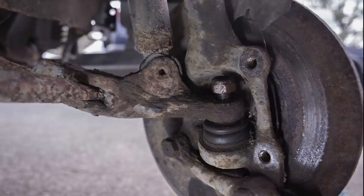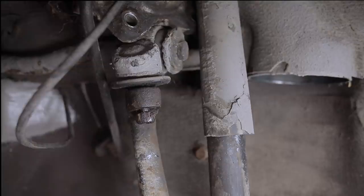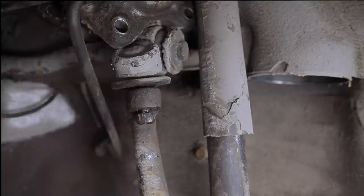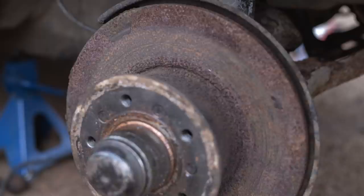It almost goes without saying, throughout this video and throughout any build, a decent hammer is an absolute must. And in a section where I want to tell you that, as far as I'm concerned, a claw hammer has no place in a mechanic's toolbox, I still managed to catch this ball peen in some of the brake wiring. Hammering on the side of ball joint tapers is a no-brainer, because the odd time that they do just release easily, it's a joy. I personally would prefer to go at them with a proper tool, i.e. a ball joint splitter, than just reaching for a bigger hammer, which is not guaranteed to work, and runs the greater risk of damaging something.